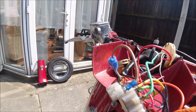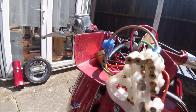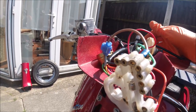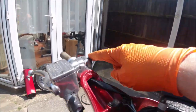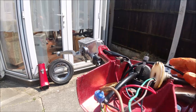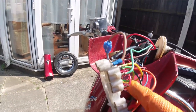When you do one click for just normal ignition there's no lights; then the next click you'd have the pilot light — I've got my thumb on it — and your back light and brake light. Then when you put it on to the other switch you're putting proper AC on, and that comes through this orange back to the switch and then depending on which way you have this switch — high beam or low beam — it just switches between the two.